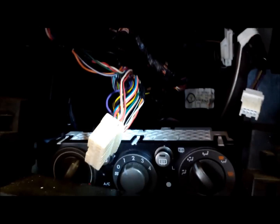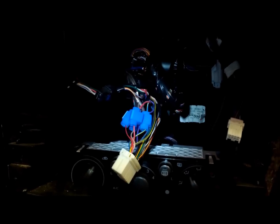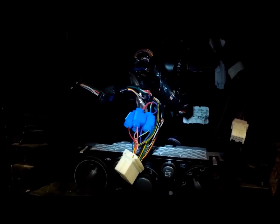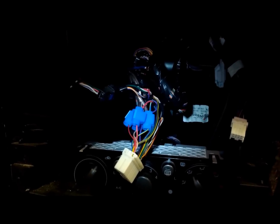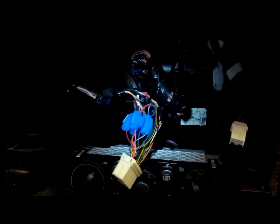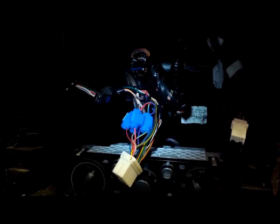I'm going to do the splice and we'll be able to put it back together. I finished splicing in the speaker wires. Next we're going to need a remote wire to turn on the amp — it's going to be the yellow with the little black tracer. In the world of manufacturers they call it a power antenna wire, so we're going to splice into that. That will turn our amp on and off with our ignition switch, so when the key is off the amp is off and we're not drawing and killing the battery.